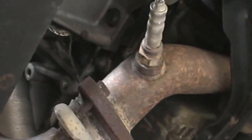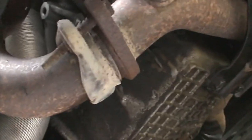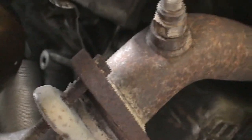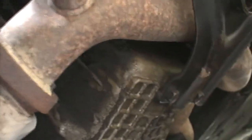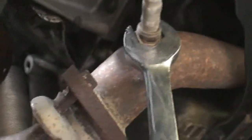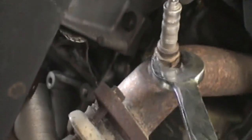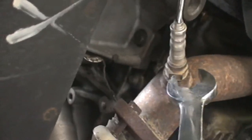Be careful, don't break it. Make sure you unplug it. Some guys would do it without unplugging it, but I find that spins the wires and puts a lot of stress on them. If a wire comes unplugged, your car's not going to run right — it's going to throw a code. Your check engine light's going to come on, if it runs at all.